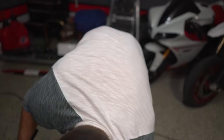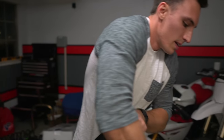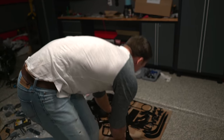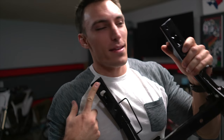Now we're going to mount it — let's actually mount it to the rear frame first. Here is something I forgot to do with powder coating. You all got excited about how many times I said 'mask off' in the last episode. The parts right here need to get masked off, but the parts you also have to mask off are on the rear frame — where it mounts right here on top of these holes. You're going to want to make sure these are masked off. Since these didn't get masked off, I'm going to grind them down a little bit with the Dremel.